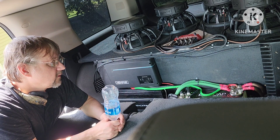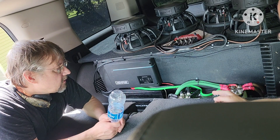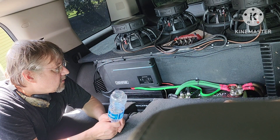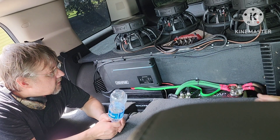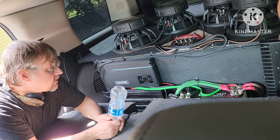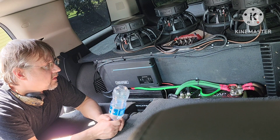The supercapacitor requires a battery to turn on — you can see the little green light right now. That green light stays on unless you disconnect the power from the battery. If you remove battery power, it turns itself off, and you could even short the posts together and nothing would happen. It has to see a battery to turn on. When the alternator kicks in, it changes to a different state. It also has an app — 15-year lifespan, really impressive.